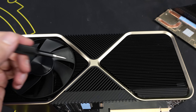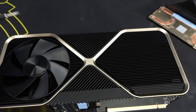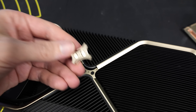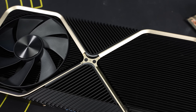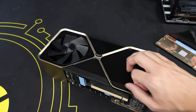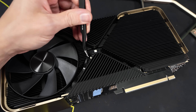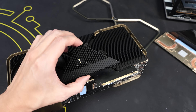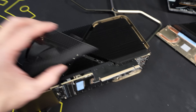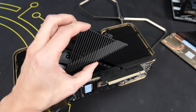We have to remove the centerpiece now — I have to be careful not to scratch and damage it further. You can already see marks where somebody before me tried to open this and abused it a little bit. It's held down by two magnets which attach to the screw heads. With this we should be able to take off the center frame. On this piece too, you can feel how this DNA went into the 5090 — a similar backplate piece behind the PCIe PCB holding it down. Nice to see the evolution.